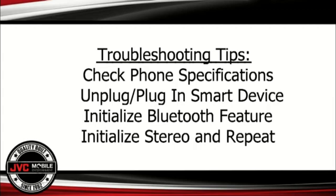You can initialize the receiver by going to Settings, System, Page Down, hold down Initialize, and then use the pinhole reset key on the front of the faceplate to initialize and reset the head unit.